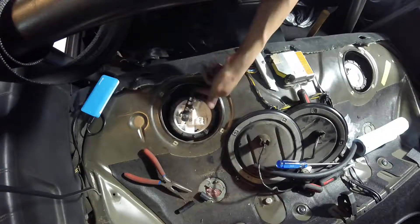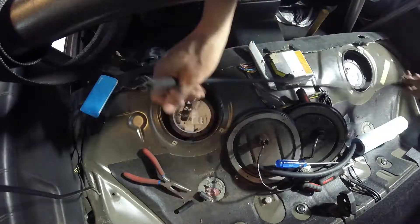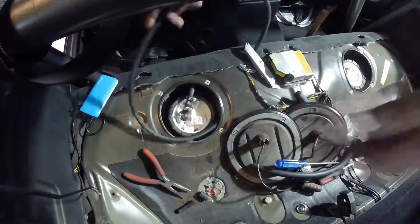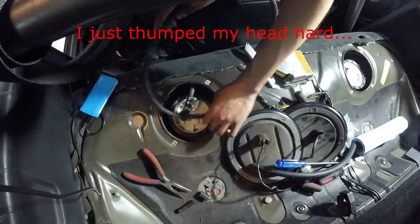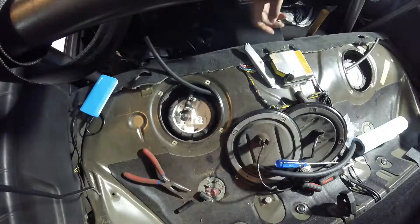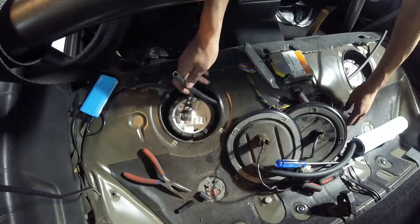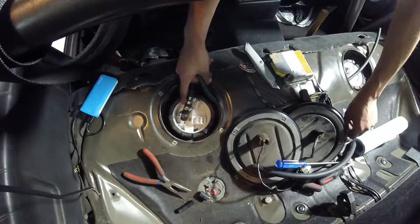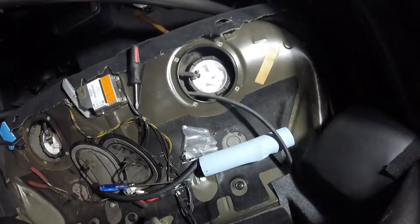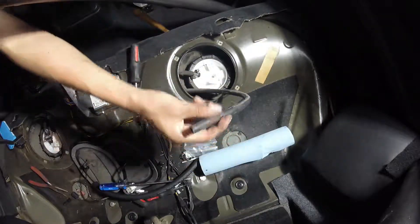This is what it looks like: the small hose into the reducer — in this case it's actually enlarging it — and then 12mm hose on that connected to the big nipple. This is all tightened down and ready to go. Make sure there's no crimp in the bend. The next step is to take our longer 8mm hose and, just like how we removed the other hose, we're going to feed it between the sheet metal and the fuel tank and feed it to the other side. Now that it's pulled through, I'm just going to connect this to the small nipple on this side with another hose clamp, then do the same thing on the passenger side.